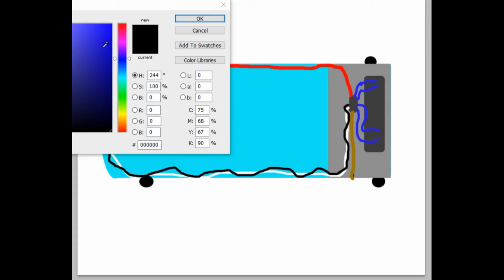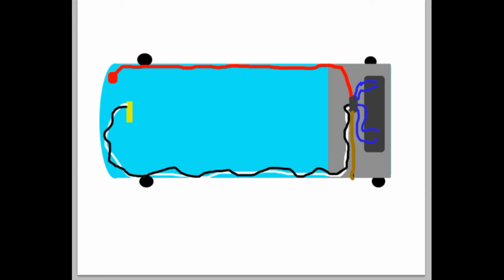It's your remote wire, and it's normally a very small wire, like 24, 26 gauge. It's really, really small, and it'll typically be blue. That also will run from the back of your CD player. You'll have a remote wire running from the back of your CD player, if you have an aftermarket, new CD player.